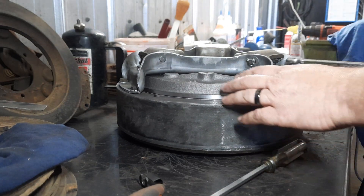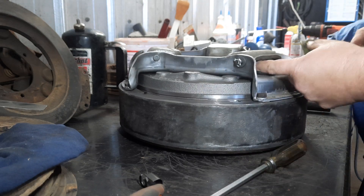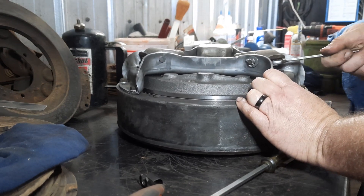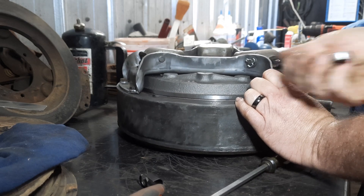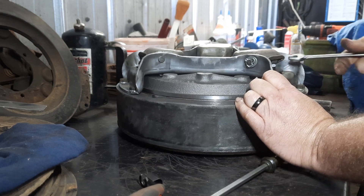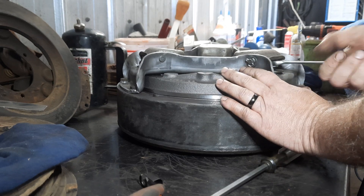What we're going to do is loosen the jam nut, and I like to spin them all the way up so I can get a full adjustment. We're going to tighten these back down to move the fingers back up, because as I said when I started to tighten the pressure plate to the clutch drum the fingers were touching inside and I couldn't get proper torque.